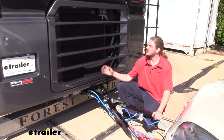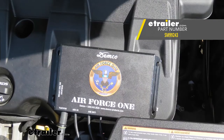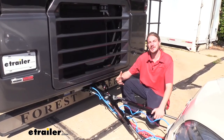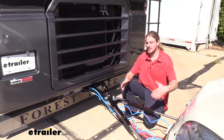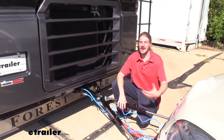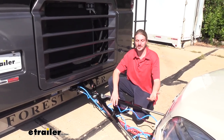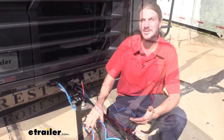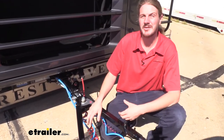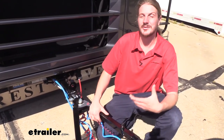The Brakemaster system is great if your motorhome has air brakes. However, my preferred braking system for air brake motorhomes is Demco's Air Force One. It operates fairly similarly, but the cylinder installed on your brake pedal doesn't go between a bracket and the pedal — it's actually mounted on the pedal and stays there all the time. It's considerably smaller, which allows the system to just be ready. All you have to do is hook it up and go, because the cylinder is always installed on the pedal. When you want to drive, you just disconnect, hop in and drive. With the Brakemaster, you have to remove and reinstall that cylinder each time, which is tedious — which is why I prefer Demco's Air Force One since it's completely maintenance free for the user.